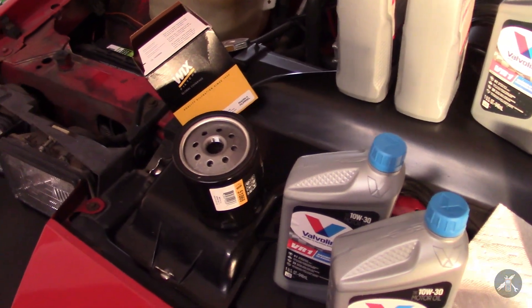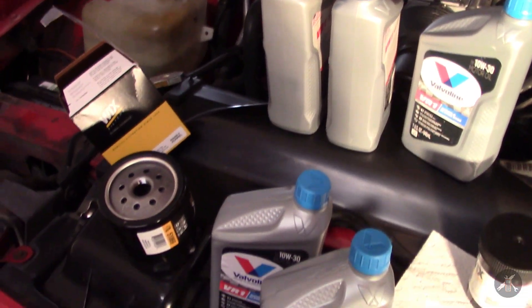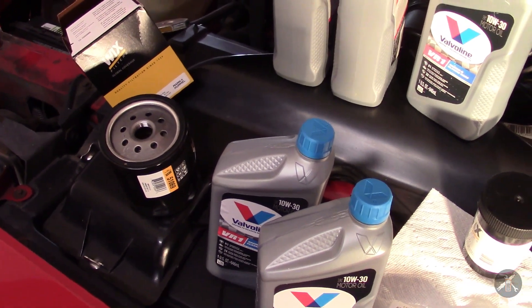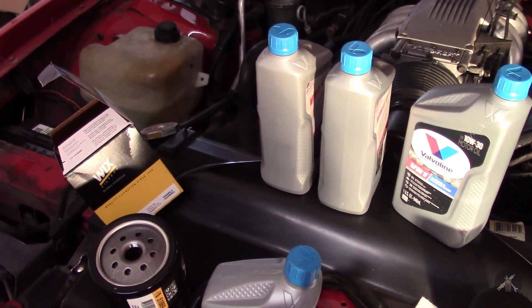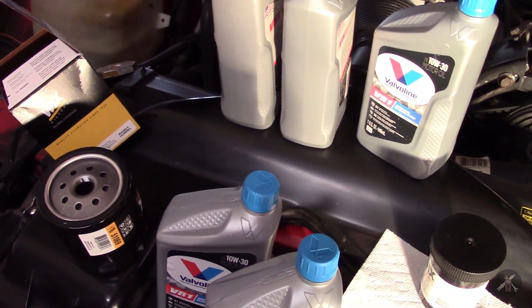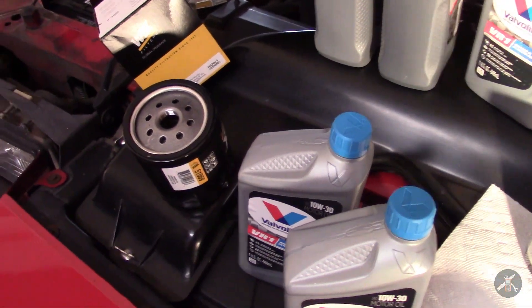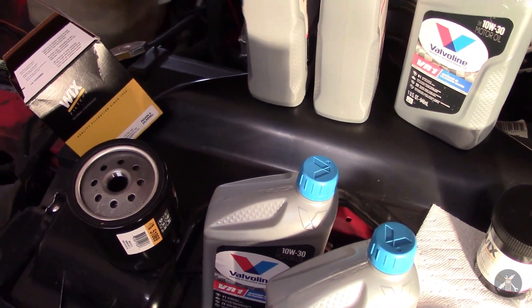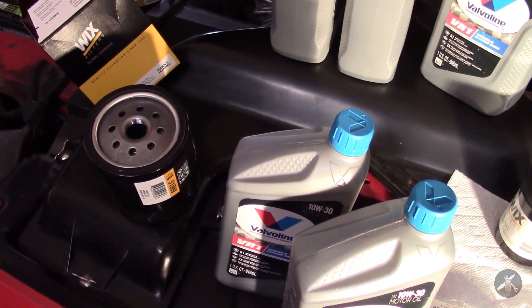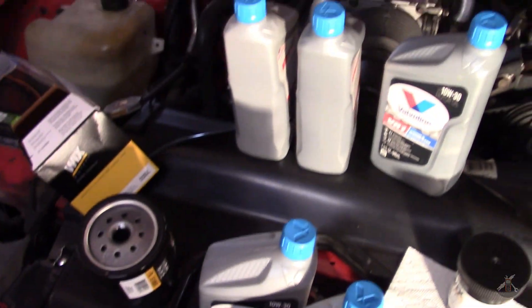As I'm going into this oil change, I'm still using Valvoline VR1 10W30 with the extra zinc in it. I really don't know that that's a requirement — I'm pretty confident in some other oils for anti-wear, and all oils still have zinc at some level. But given the fact that I lost a cam on an engine really early, I'm in the not-take-any-chances camp. I've got a fresh Wix filter and five quarts of VR1.